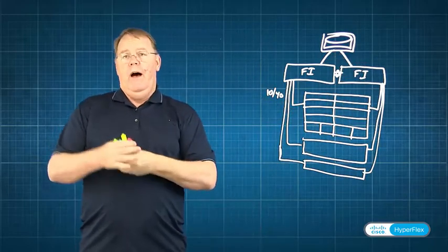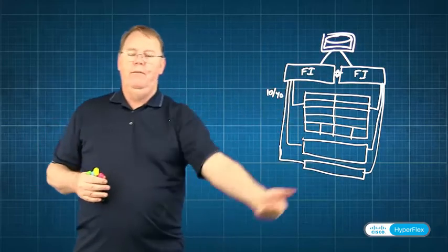And by adding those servers, it gives me a flexibility to take an identity that might be, if I put an identity on a rack mount server where I would have local storage, and I want to move it to, say, a storage area network, a SAN, I would build my SAN out, connect it to the fabric interconnects through either iSCSI or through fiber channel into the fabric interconnects, and then I'd present it down to my servers. I can then take the storage that was here, move it up here to my fabric interconnects.